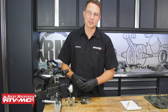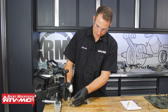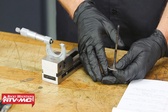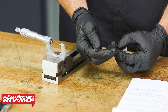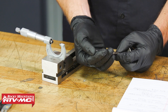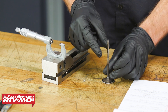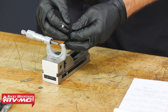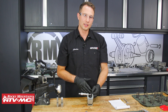If you do suspect that happened, our manual tells us to check for runout in the middle of the valve stem. As I rotate this one, it's pretty dang straight, so we know we're good. The other inspections we need to make are to the valve face — make sure it's not pitted or burned, and make sure it's not cupped out. On the end where the keepers go, make sure that's in good condition and that the end of the valve isn't flared out. If all that checks out, we're going to take six measurements on the stem — three going up, then turn it 90 degrees and do three more. A quicker way: set the micrometer at the smaller end of the service limit and try to insert the valve in all those locations — if it doesn't go in, the valve is still within spec.